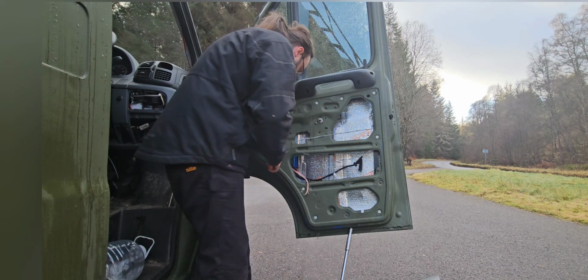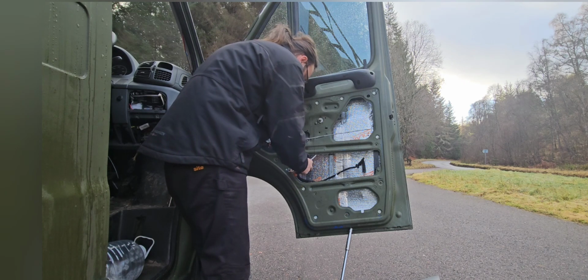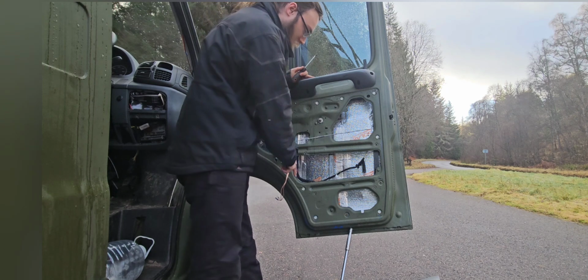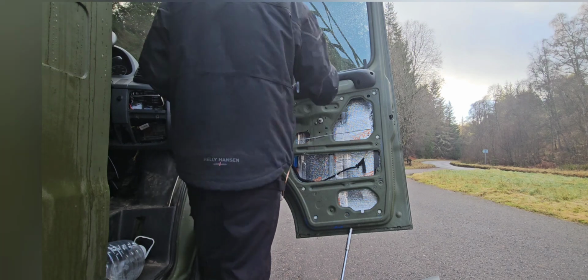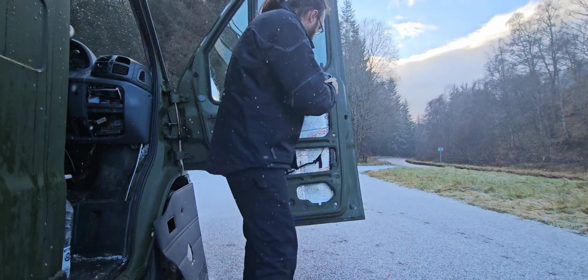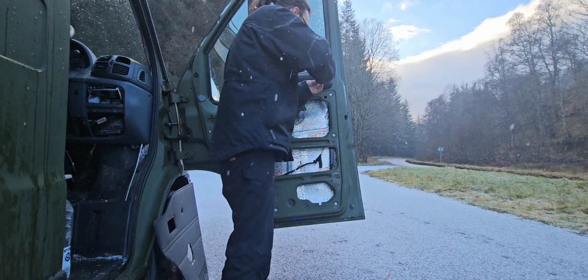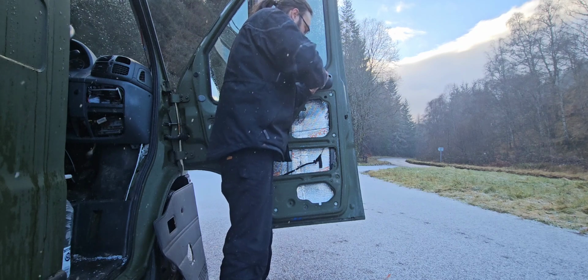And then in the back here is your wiring loom for everything else. So I've just got to quickly pop that back up here. Carefully. There we go. So then all you've got to do, they're all 10mm bolts all the way around. So that's easy enough. This here is a T20. Take this off. So we finally found the right bloody thing. So you're going to have a weird cut in a minute. I'm just trying to explain to you how this one comes apart. So when we put it back together, we can just do a hyperlapse. Put it back together. That's the first door done.